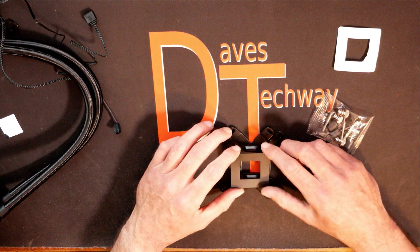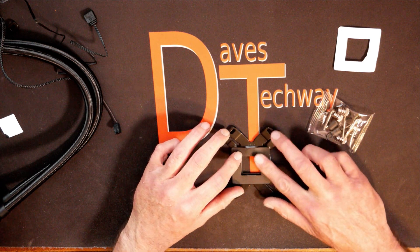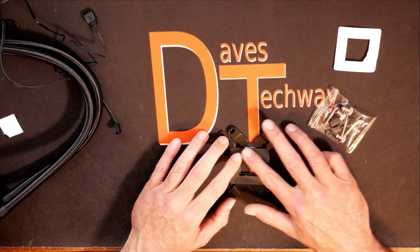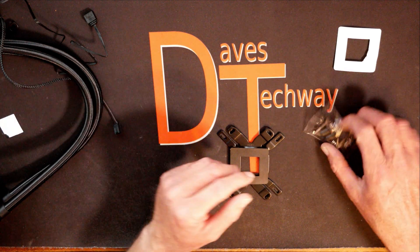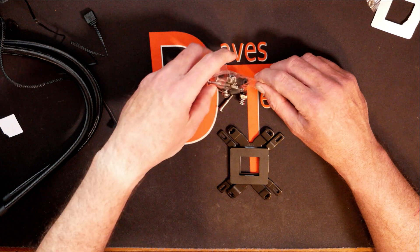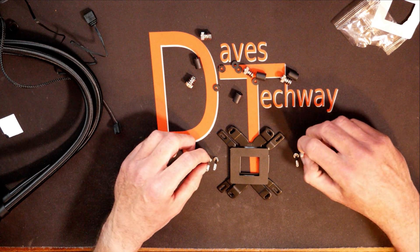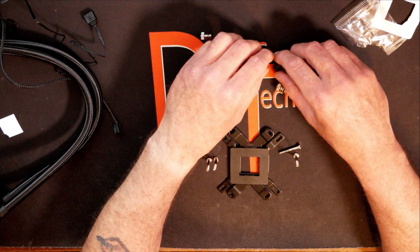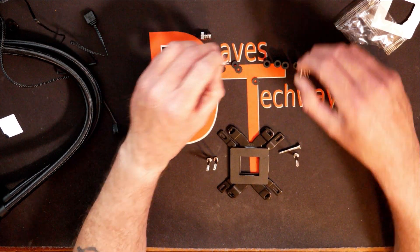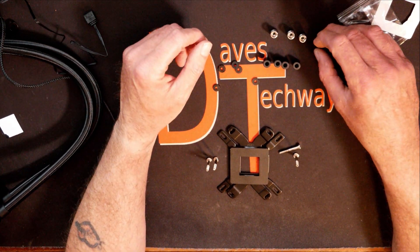It's good to have when any kind of metal is touching your motherboard. Line it up with the square right there in the middle and just push it down. The only thing it's really going to connect to is those four pieces, but that's apparently the way they want it done. Let's get this little bag of goodies pulled out — here we have the four posts that come up through your back plate, two for each side. We'll also need the four little black standoffs and the four thumb screws with the springs.